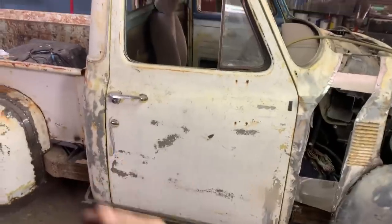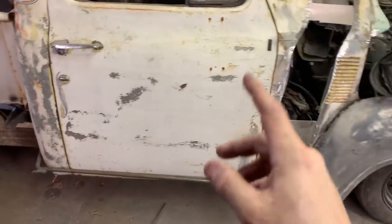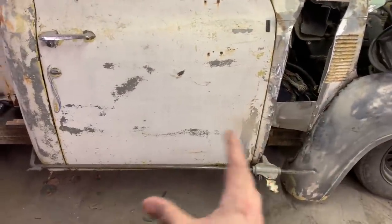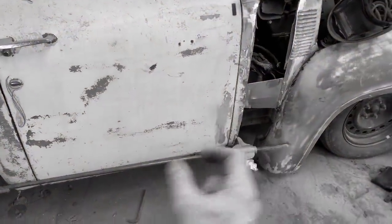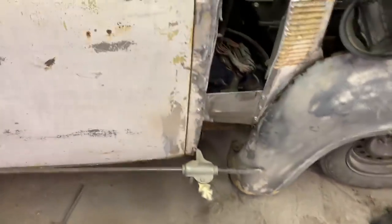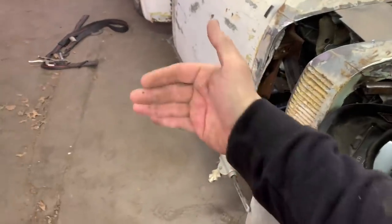I got the door actually fitting pretty well. Took some ratchet straps and a jack — my dad was helping me. I got a decent gap around it; the top is still a little high but I can adjust that. What I'm running into is since the cab corners aren't solid, whenever I let go it opens back up and I have like a half inch gap. So I need to make my corners solid — I'm going to put some little brackets in there to the frame or the vehicle floor so nothing can spring either way.